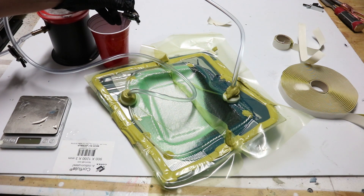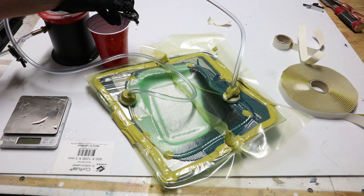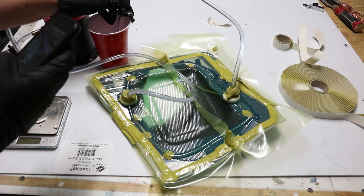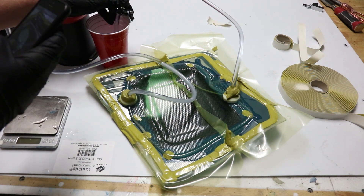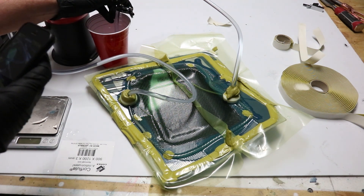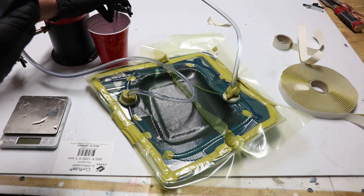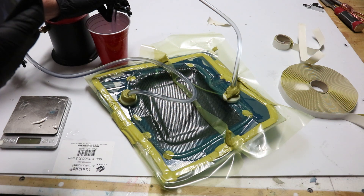Since making the first video I've been told that I shouldn't have had the spiral wrap running the entire perimeter of the part and linking the two vacuum bag connectors. It's better to leave a gap so you won't have big voids in the resin like this. That being said, on this small part it's worked out okay, but it'll probably come into play when I get to the roof or the bonnet.